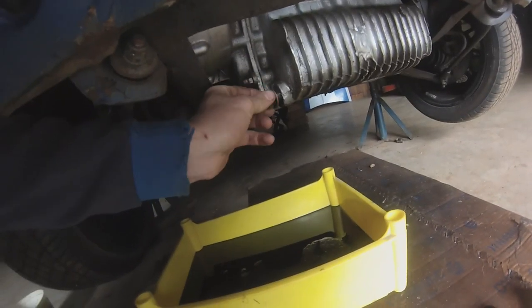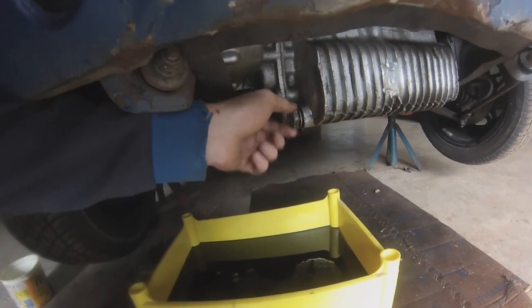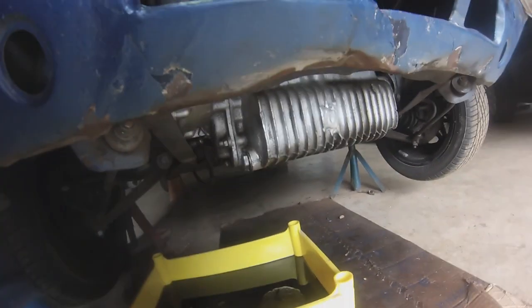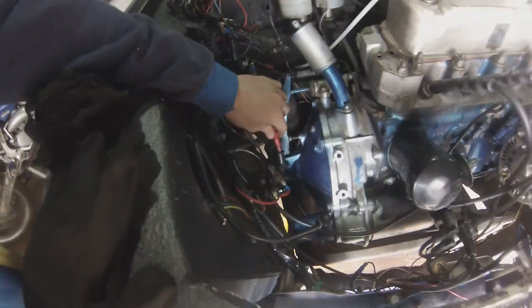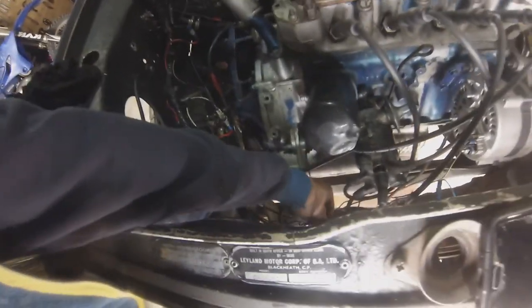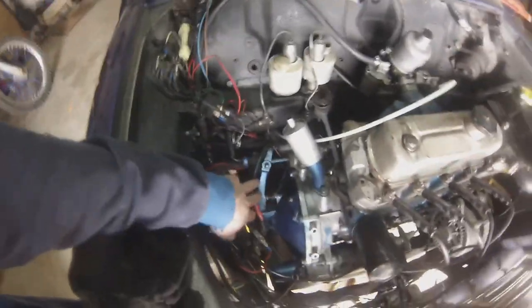Get in there. So let's put that in. I'll tighten that just now, but that's all right for now. Now I think what we should do is disconnect all your electrics on the car: distributor, your positive wire coming in, your negative side of your distributor, your solenoid — positive side coming in from the battery, your negative side of the solenoid going to your starter motor, and then your ground from coil to distributor. Watch these cables, these HT leads. And possibly your alternator — the rest of it actually isn't in the way. So yeah, let's do that.